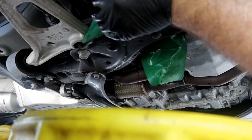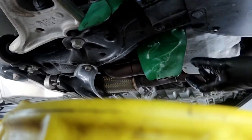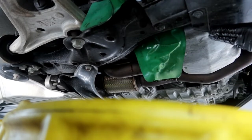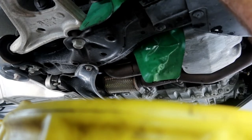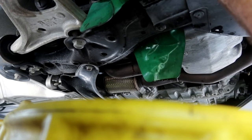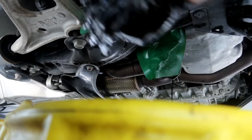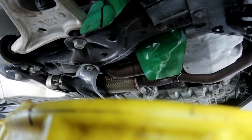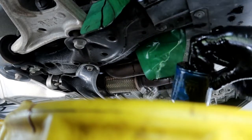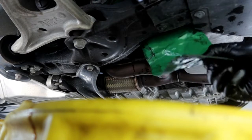There is a little warmth and there's something that's going to drain out of here. I'm not sure how much you guys are able to see — I've got a Forma Funnel sitting over the top of the crossmember. I reached behind and loosened up the oil filter with the wrench. Let's take that oil filter the rest of the way off. Drain everything out of there. That should be it for the Forma Funnel — let's get that out of the way.